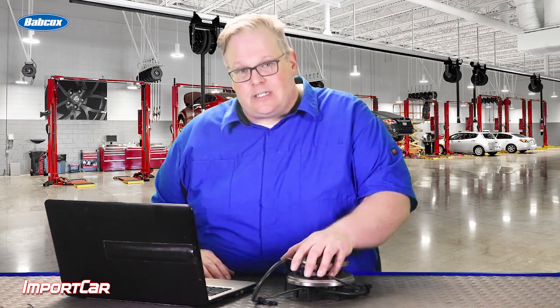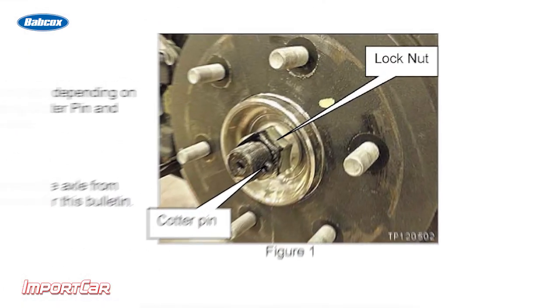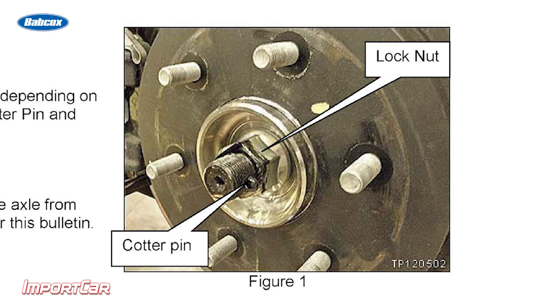So what is the issue you're really dealing with on the CV axle? It's actually the CV axle interacting with the wheel hub unit. The two surfaces — the shoulder on the CV joint and also the inner hub of the wheel bearing — they interact, even if they're at the proper torque. They move slightly whenever the vehicle accelerates due to the forces on the tire and also from the engine itself.